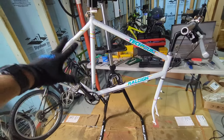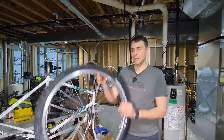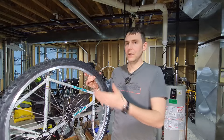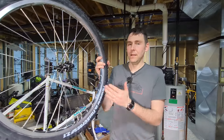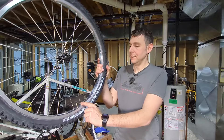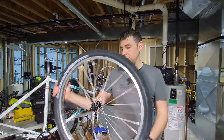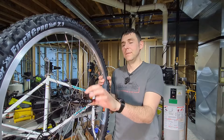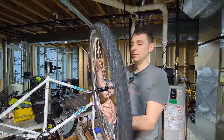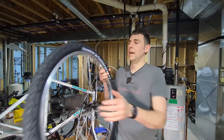It's a little bit later - actually several weeks later - and I finally built the wheels. Here's the front wheel. The rim is a Sun Ringle Rhino Light and I really like this rim - very affordable, only about $30-35, and it comes in different finishes including this crazy high polish. I normally wouldn't go for that but I think it's really going to pop on this bike. The hubs are Shimano Deore from their trekking line - no disc brake mount, just a straight hub. Pretty basic but Shimano stuff always works really well. The spokes are DT Swiss 14/15 gauge double-butted.